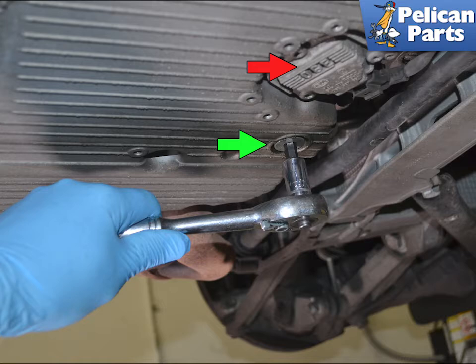The Billet Racing Service deep oil sump can lower temperatures by up to 40 degrees Fahrenheit by providing increased oil capacity. More capacity means oil takes longer to overheat and break down. The sump brings total capacity to 9.5 to 10 quarts.